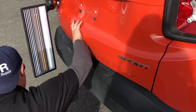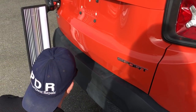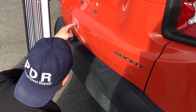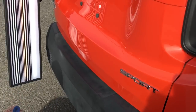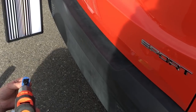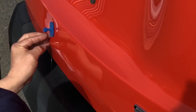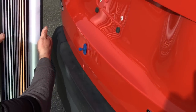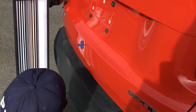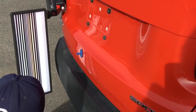It's two-year-old factory paint, it's a nice Jeep. We've got the glue gun all warm and what I'm gonna do first is start with a larger tab, but I'm only gonna put like a little triangle of glue in it. There's only like a little triangle, and then I'll come down with a little drop off that triangle and put it right in the center of that dent. We're not gonna let it dry too long, and I might even use the mini lifter for this one.